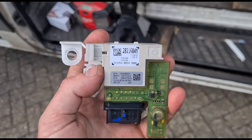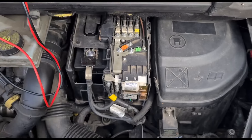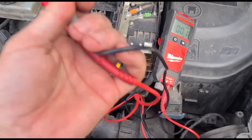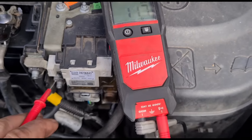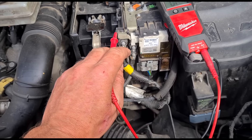I'll show you how I diagnosed that last time. I've got a multimeter here ready. I'll take this off and we've got this unit right here. We've got it wedged into the earth over there, and if we come across here into that, we've just got 1.9 volts. If we come to the other side, we've got 12 volts just about. So the power is going into this unit but it's not coming back out.